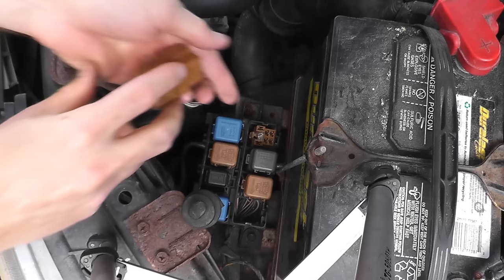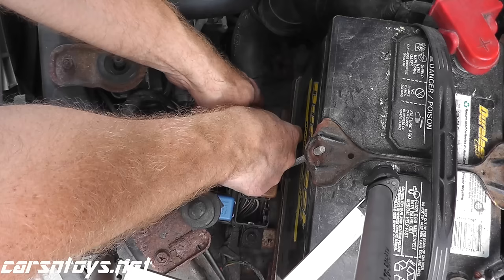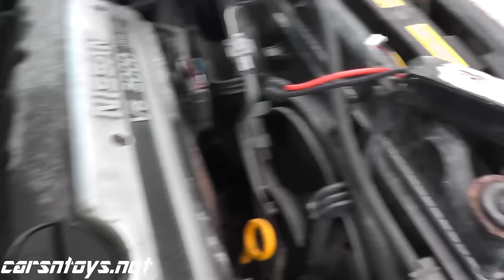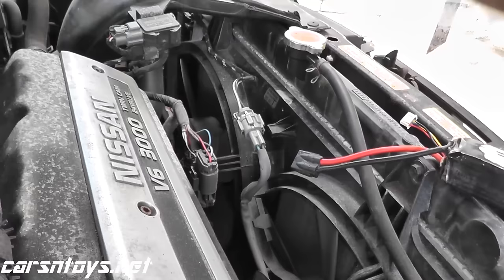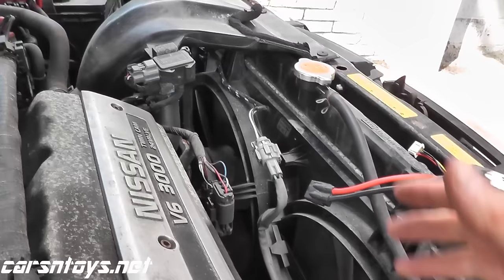Now if you test the relays and they're in good shape, the last step is testing the fan motor — which we've already done and know is in good shape. So if the fans aren't working, these are the steps you have to go through. Chances are, if you're having a problem with the fan, it comes down to the relay or most likely the fan motor itself. It's somewhat rare to have a wiring break in newer cars unless they've been sitting so long that rodents or insects have chewed at the harness connectors. I hope this helps someone out there — if you like this, please thumbs up, subscribe, and we'll see you next time.